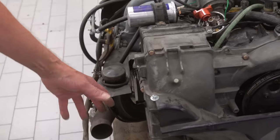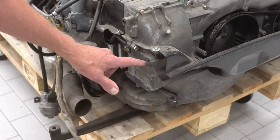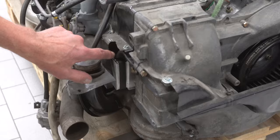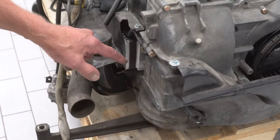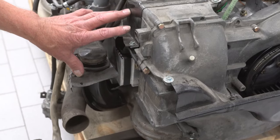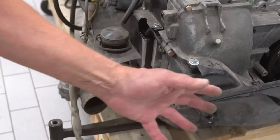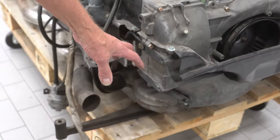You can see something is missing here — there is something missing. This is where somebody originally mounted an air conditioning compressor at the dealership when this car was sold new. It's been taken off and you can see the butchery: somebody got a cutter and just cut the sheet metal just enough to fit the compressor on. A lot of these installations were done beautifully; others were hacked like this one. The solution is to buy a new piece here and here. Also, the accelerator cable used to come up into the engine compartment here — now it's misrouted over the front because with the AC compressor there's no place for it to go.